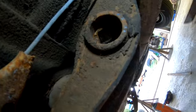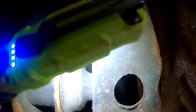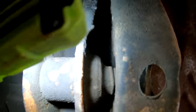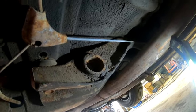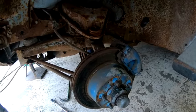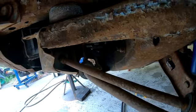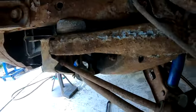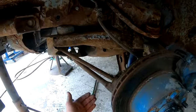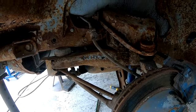Granted this is a very short piece since it's broken. Putting the new one in is as simple as pushing it through. The only challenge is there's a rubber boot that the first nut has to get pushed through - I'm going to grease up that boot a little bit so it slides through easier. In the process of putting it back together, I remembered I forgot to loosen the lower control arm pivot and bushing nut a couple of turns so the arm swings freely enough to get the torsion bar to line up correctly - I was having a heck of a time until I remembered that.